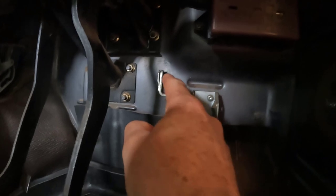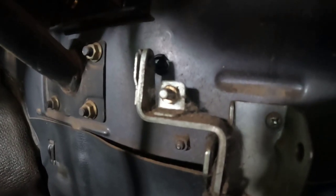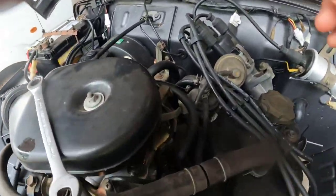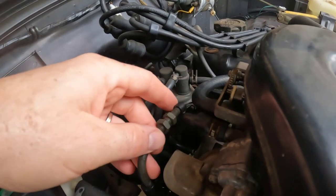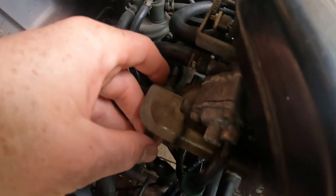I had to stick a screwdriver in from this side and feel it from the other side, and I managed to get it through. I broke off one of those four little tabs — these little clips always get brittle, so I'll probably just order another throttle cable and keep it with me. But this one is in there. Now on the other side, we have to fit it back — first just see that it's routed properly, and it is. Hook it back onto the carburetor linkage — it needs to go under this pipe. Got it hooked in.